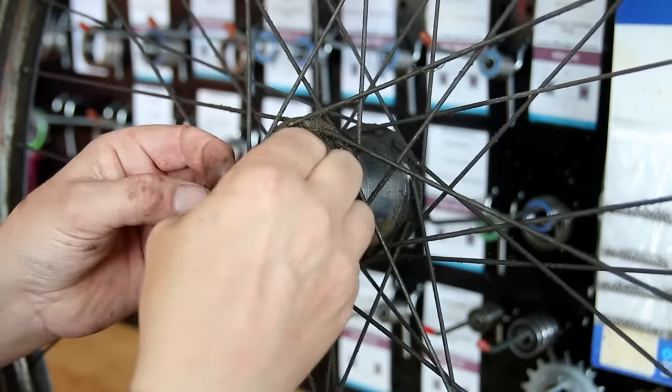Now I'm doing a repair on the mudguard — the stay was broken off, so I'm welding that back on with a couple of spot welds. I blew a little bit of black paint over the weld to stop it going rusty, and also over the extremely rusty bottom section just to stop that rust progressing. The front mudguard was deformed and almost flattened at the bottom, so I'm putting a little curvature back in so it sits better to the shape of the tyre. Then the mudguards go back on the bike.